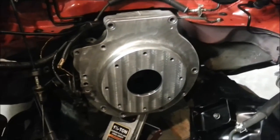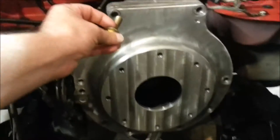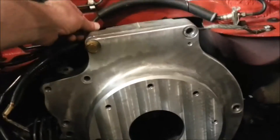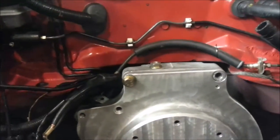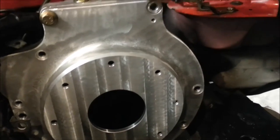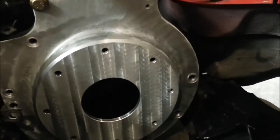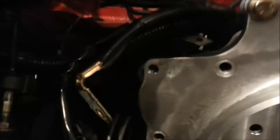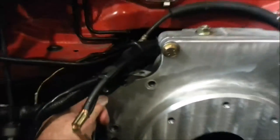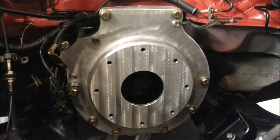My workbench has exploded into a complete mess, but here's the final finished machined gearbox adapter - let's see how that fits in the car. Absolutely perfect! I've found some automotive-style flange head bolts, and once we get the flange head nuts to go with them it's all going to look perfect. There's an extra tapped hole on top for connecting the earth strap, a tapped hole in the top corner to mount the cable bracket, and that will hide the little lug sticking out.